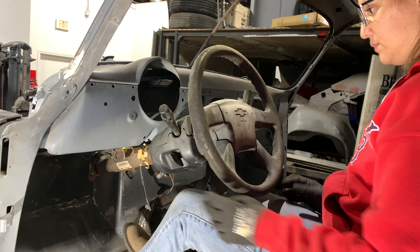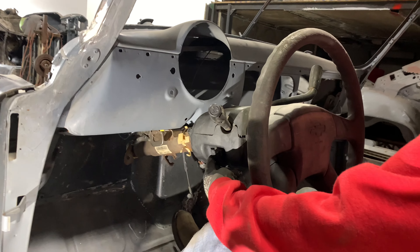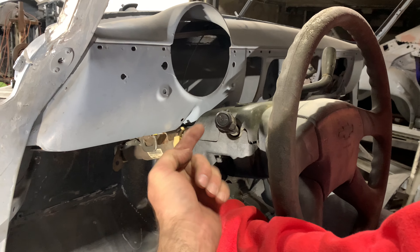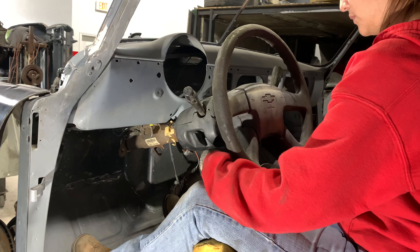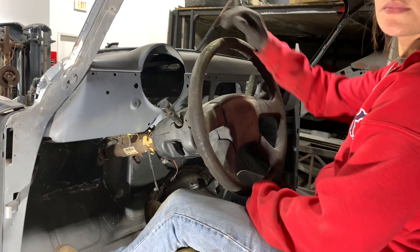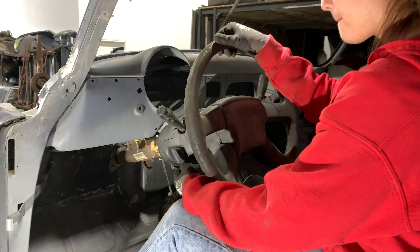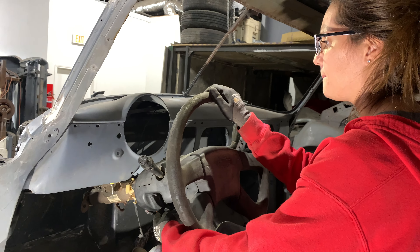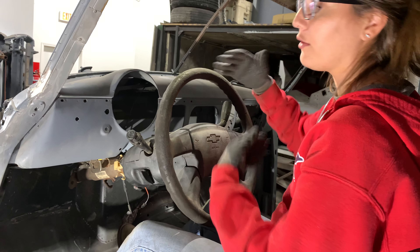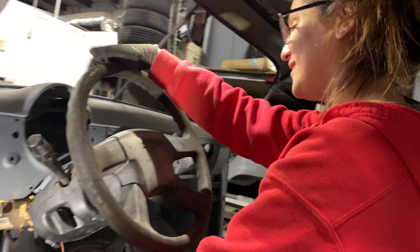Go through the full motion on the steering wheel, all the way up and all the way down. The steering column is going to go up into the dash, because right there is where the old steering column was — we're going to make that opening bigger. When the steering column goes north two inches, Bridget, will you still be able to see the gauges through the steering wheel? Oh yeah, definitely — it'll actually be even easier to see the gauges, and the top part will probably be in line with your eye level. How tall are you? Five-two and a half.